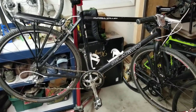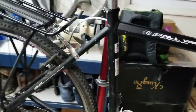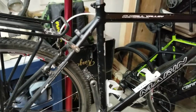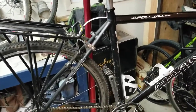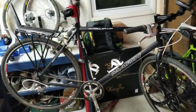The next thing I look for is brakes. This is a v-brake bike — when I picked it up it actually had cantilevers, with a cantilever hanger here and a built-in cantilever hanger in the front. I converted it over to short-pull v-brakes for more braking power and easier maintenance. Cantilevers work fine if you have patience to set them up right. I would also be okay with a disc brake setup — you're probably not going to find disc brakes on cheaper older bikes, but I wouldn't rule them out.